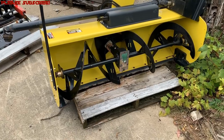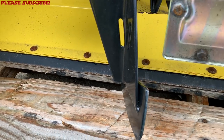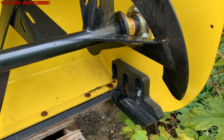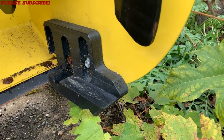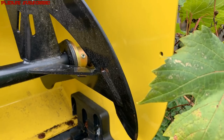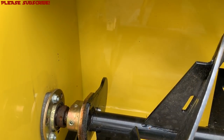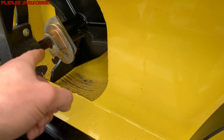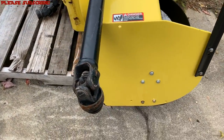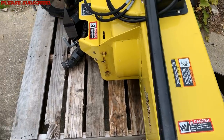If we look at a newer John Deere snowblower, you can see the difference in the cutting edge — it has a decent amount more life left in it, that black edge running across the bottom. This particular unit has nylon or plastic skid shoes, which are an option from John Deere or an aftermarket company. You still have shear bolts on either end, and there's also a shear bolt tucked back there as well. Make sure you get it greased up on the grease fittings too — some items have more grease fittings than others, and some won't require grease at all.